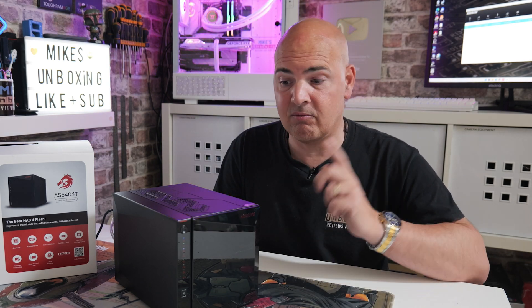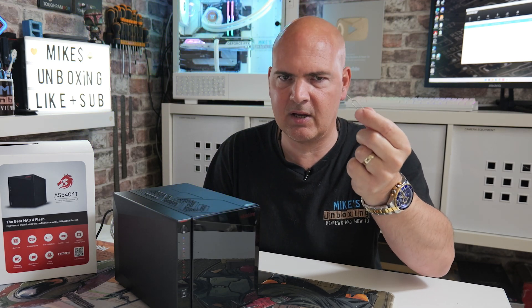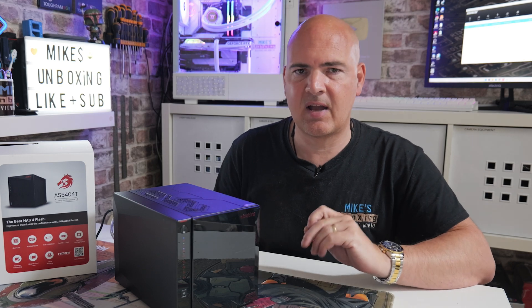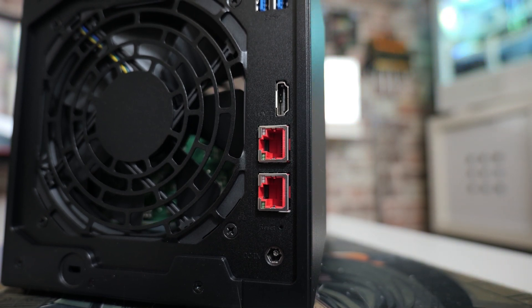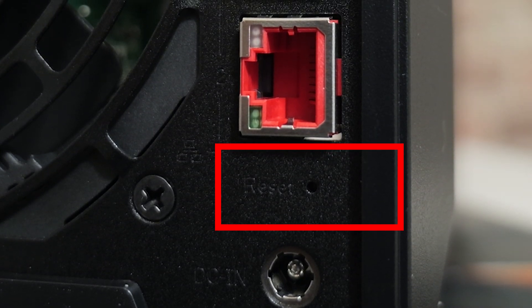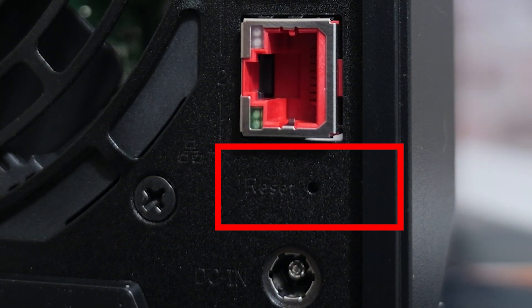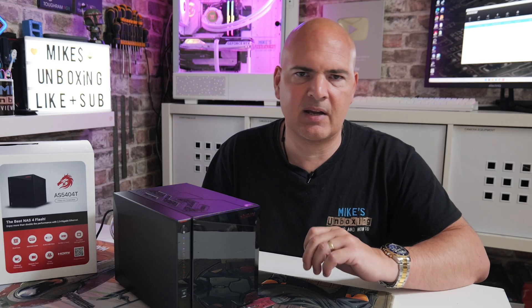So let's start off with how to actually reset these units. It's really easy to do. All you need is a screwdriver or some kind of pinpoint tool — a pin, a SIM card removal tool, that sort of thing. Then all you need to do is take a look at the back of your NAS device, and normally just below the Ethernet ports or in between the USB ports, there will be a very small indentation. Press that little reset button in for around five to ten seconds until you hear a single beep, at which point you can release it, give it a few seconds, and then you should be able to log in.